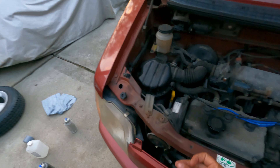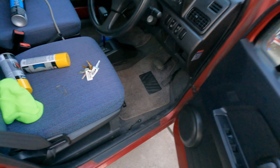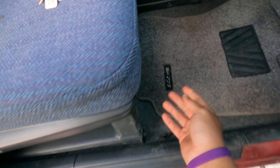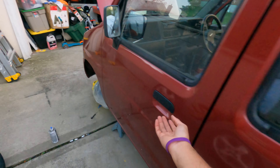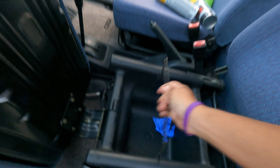Quick update: I jumped the compressor with a bobby pin, turned the car on, added some freon, and it kicked in right away — AC blows ice cold, which I love. It's still kind of cold in New York right now but I'd rather get it working now than later. I did three coats so far and you really only need one can to be honest. Shout out to my homie Michael who also has a Wagon R — look at this: there's a drawer here and a cool little passenger grocery basket on this side.